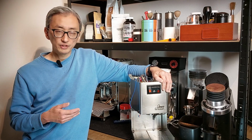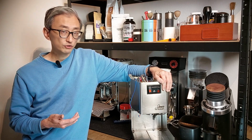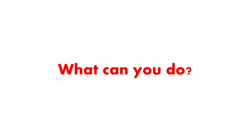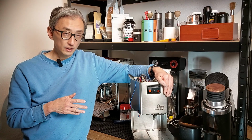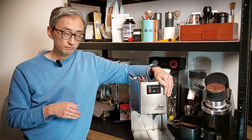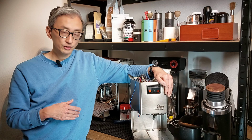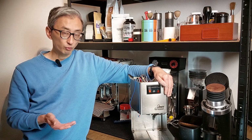How can I prevent this? How can I increase the longevity of my espresso machine? How can I reduce my cost of maintenance? If your water is hard, above 150 ppm, I would consider softening the water, using bottled water, or maybe mixing distilled or deionized water with your tap water.